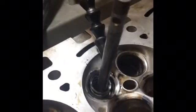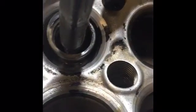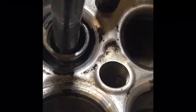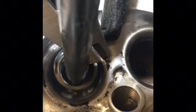Alright, pull this out, turn off your coolant so you can see our surface, and I can visibly tell that it's now wider. Hopefully not too wide. If so, we can fix it, not too big of a deal. We'll come in here and check our minimum. Get it to where you guys can see. So if you can see, we're now wider than our minimum, which is what we want.